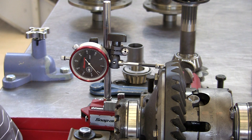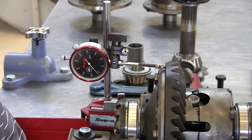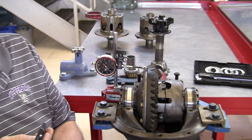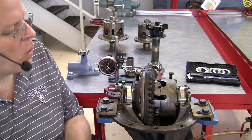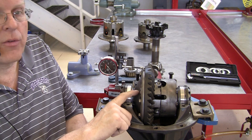That doesn't mean it won't drive down the road — obviously this was driving before. But for reliability, noise, and vibration sake, this thing is probably going to make noise. Since it would be once per revolution it would match tire speed, probably some sort of a 'wow wow wow' type of noise. We would have to set the backlash really loose in order to not bind any of the gears when they're at their tightest point, so this is a real concern.